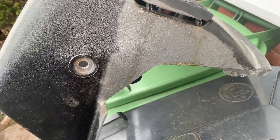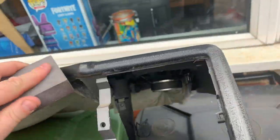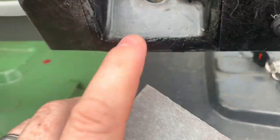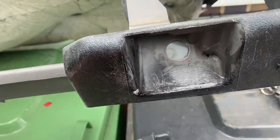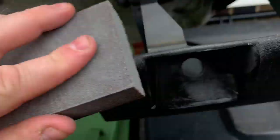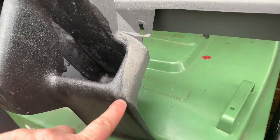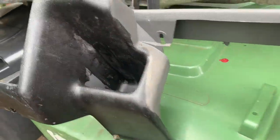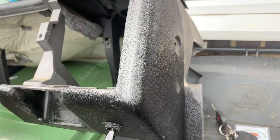So first job, I'm going to sand it down. It does need a clean, but I'm not going to clean it now because I've got to do it again after I've prepped it anyway. I'm using just normal sanding blocks and I'm going to give it a good rub down, all of it. I need to do this because there's lots of scratches and marks, and I want to try and get as many of these out as I possibly can. I might use my orbital at some point, but I'm going to go over it first by hand and see what we're left with. You can see it was done in situ because the job's quite terrible. At the end of it we might just buy a new dashboard, but we're going to try and see what we can do. Let's give it a prep and I'll be back in probably an hour.